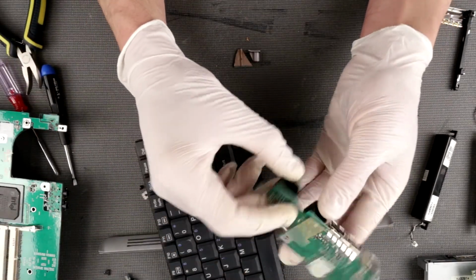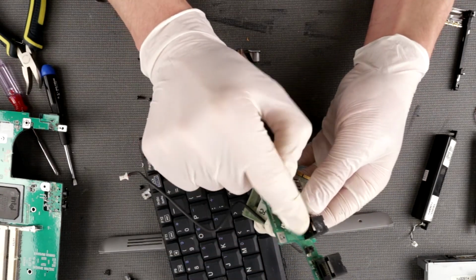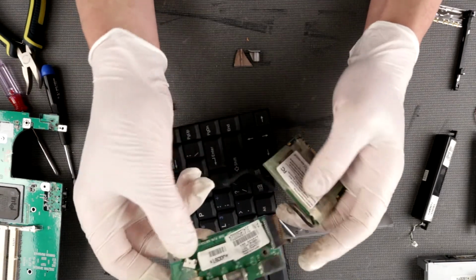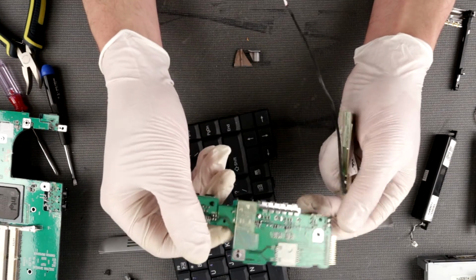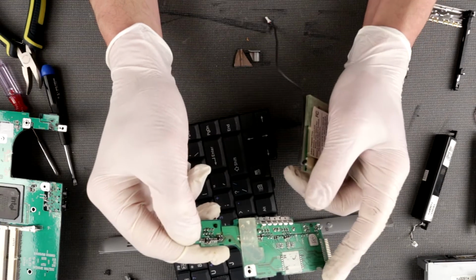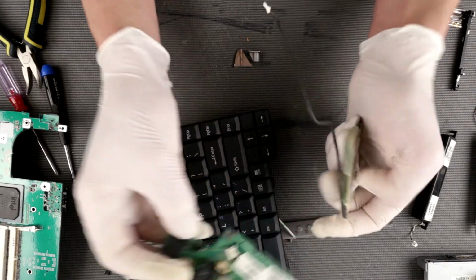Let me see, it was connected to over here. Oh, all right, it's a modem. Yes, that is a modem, because it was connected over here. And looks like if you trace those pins, they go straight to here. And this is the phone jack, this is Ethernet, which probably goes to this PCI extender, or just extender, not necessarily PCI. Because there is no logic, any computing here. Ethernet was going to some sort of transformer which is not in place. Well, this is Ethernet. Okay, so this is a modem.